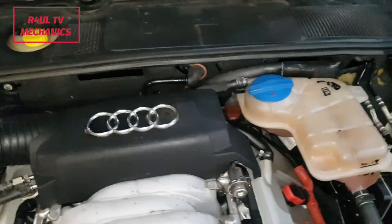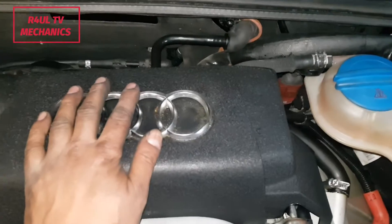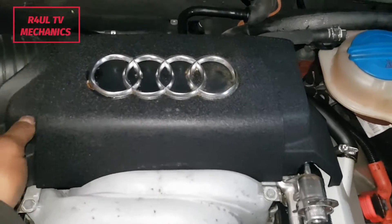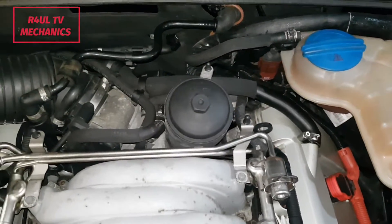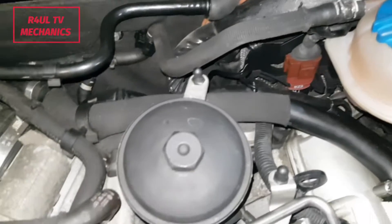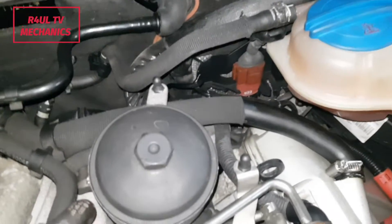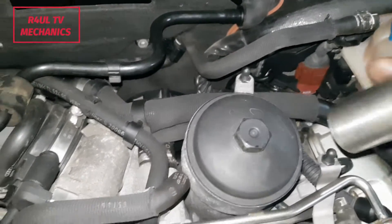So, car is sent down. What we're going to do now is the oil filter. I've drained the oil as you guys know, now I'm going to do the filter which is here. What size is that? I would say it's 24 mil — yeah, I would go for a 24 mil socket.